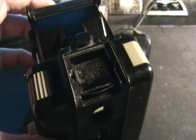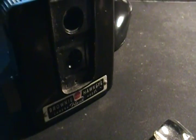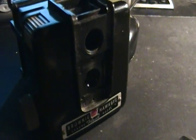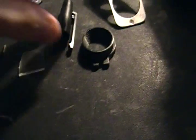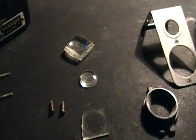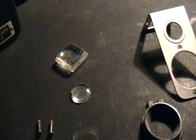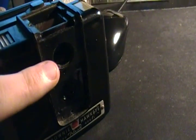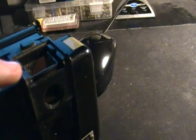Simple Windex will probably clean that up pretty good. Everything else works fine. I am kind of worried about the piece of glass that's behind the actual lens or behind the shutter — it's a little dirty. I did look at it on the inside, and this is what I actually have inside here. There are three glass elements in this camera. Two of which are the top prism — this guy right here — and then the actual second part of the viewfinder. This part actually goes in the front of the camera right inside there, and that actually goes in the top.